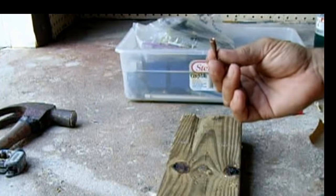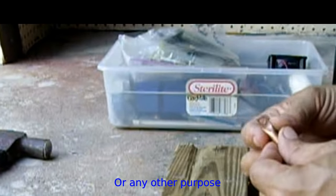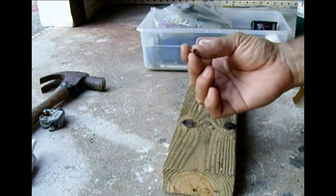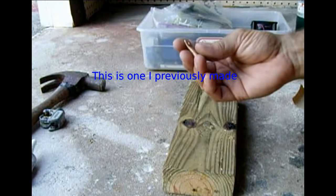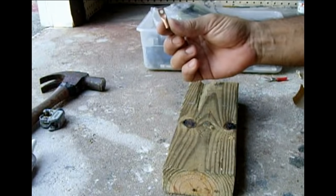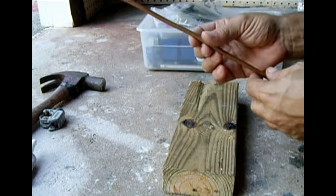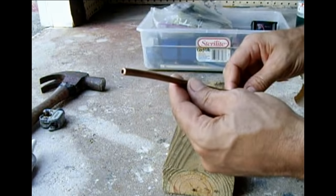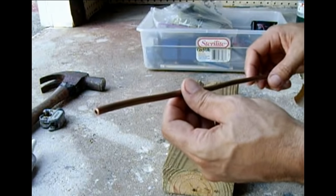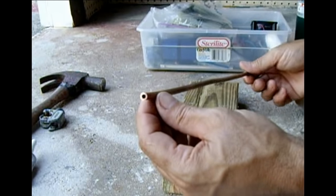In this video I'm going to demonstrate how you can make your own cable ends for marine or automotive purposes. They slide over the end of a copper cable, usually a 4 gauge or a 2 gauge. In my case, I need this for a small inverter, so this one will fit a 6 gauge wire. To make the 2 gauge ones, it's the exact same way as making the smaller one, but instead of using 1/4 inch copper, you're going to use 3/8. You want to make sure you use type K or L copper, not type M. Type M is rigid copper, and type K and L is refrigeration copper, which has a thicker wall, which is what you want.